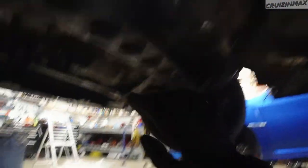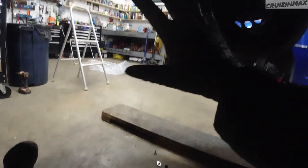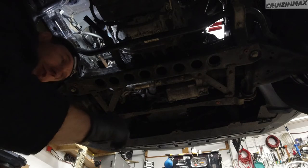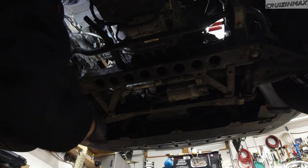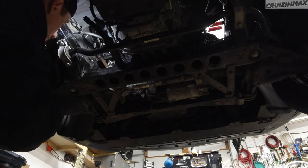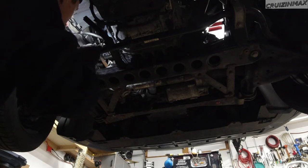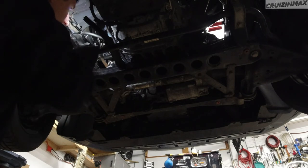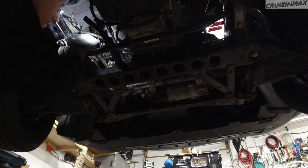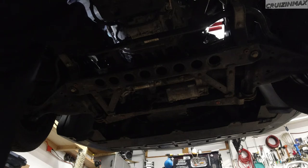And obviously there is a big cover right across this whole bottom here. Once the car is up, turn the wheel to the left and you're going to be able to take two of those engine mount bracket bolts off through the little gap. I'll show you where the wheel is.